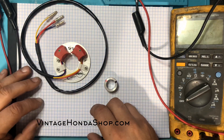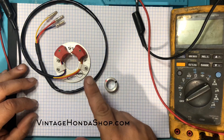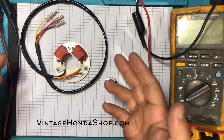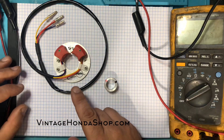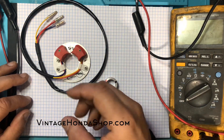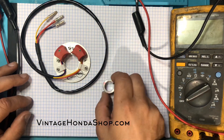They are magnetically latching. What does that mean? This is not your typical Hall effect type sensor that needs to be spinning at a certain RPM in order to make signal. Magnetically latching means that this is a true on/off switch and functions exactly like a set of points that are driven by a magnet.